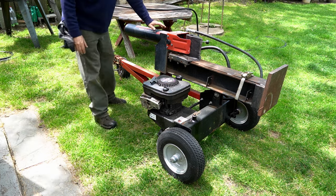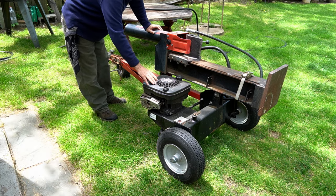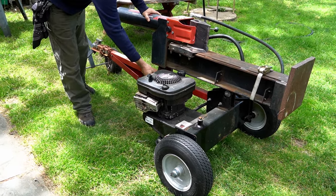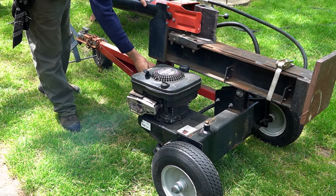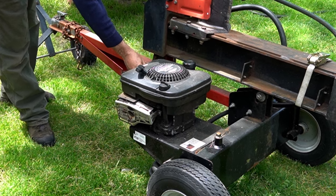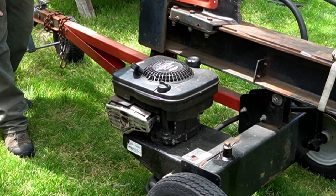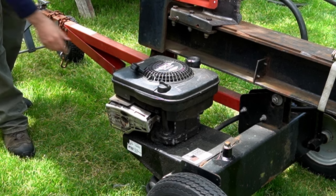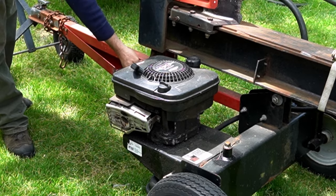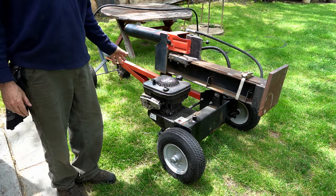Let's run it real quick and see. I don't know which way the choke goes - going to assume it goes like that. She's real low on power. I can smell it burning even beyond the initial startup - it wants a little bit of choke in order to run.